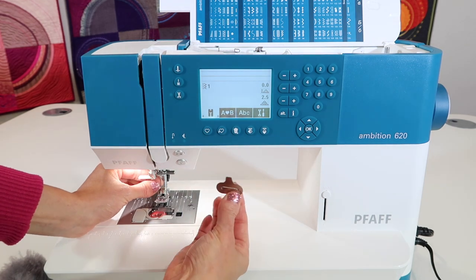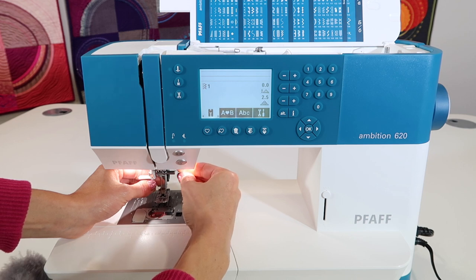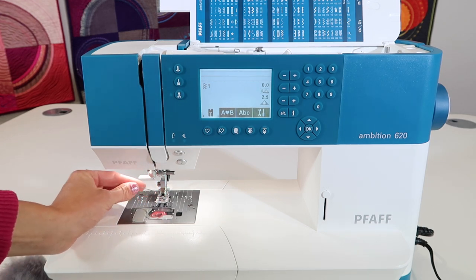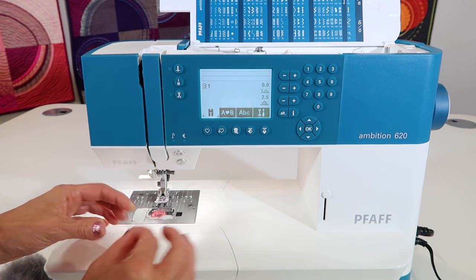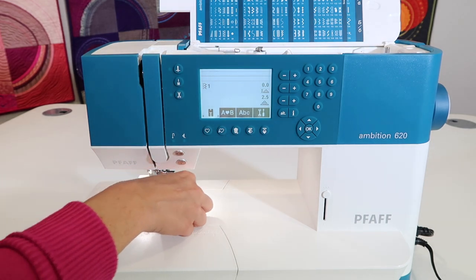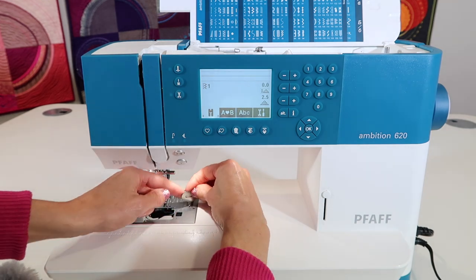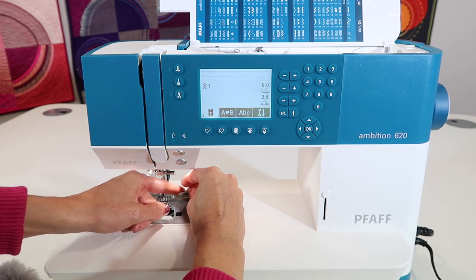Next, it's not a bad idea to use your short screwdriver to take your needle out — or the longer one, whichever is easier for you to handle. Loosen and remove the needle; you'll notice I'm going to put this in absolutely last after we reassemble. Take your presser foot off, take your bobbin out, and find your little brush — that's in your accessory box. A fluffy brush, a makeup brush, a Q-tip, all those things are helpful. The one thing you don't want to use is canned air — we don't want to blow anything into this machine.